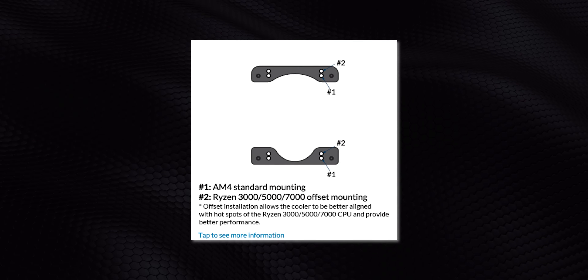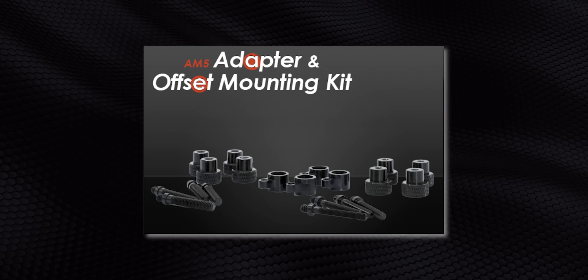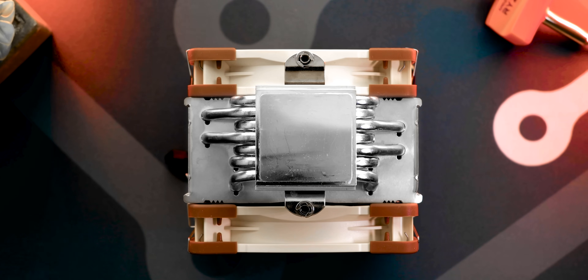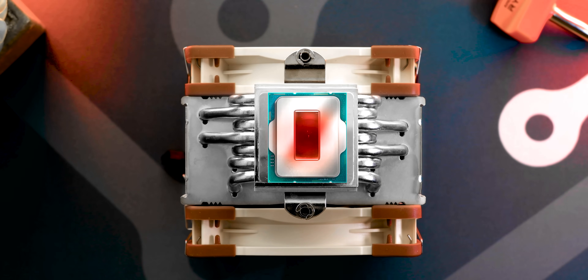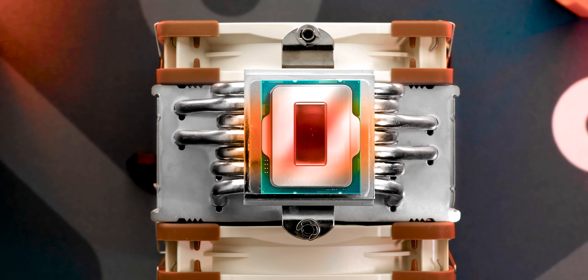Let's kick things off with the Noctua offset brackets. While these can only be used for Noctua coolers, there are other options — Arctic Cooling ships some of their AIOs with it, Thermal Grizzly has a kit, and a few other coolers coming out this year should hopefully have some form of offsets on their AMD mounting kits. Most coolers have their point of maximum pressure right in the center of their contact plate. That center target is perfect for Intel and older Ryzen CPUs since most of their heat is generated in the middle of their packages, meaning heat is transferred more effectively upwards through the cooler's base plate and evenly distributed to the heat pipes.